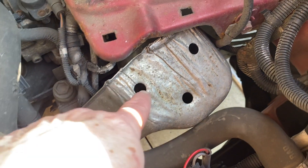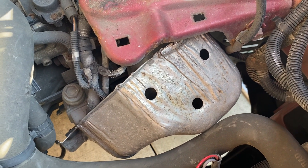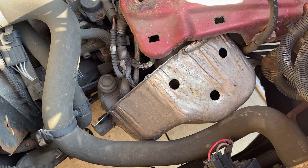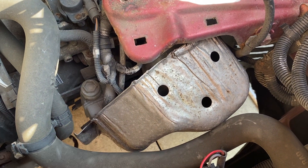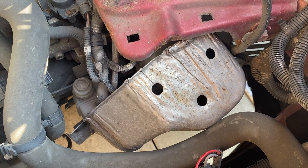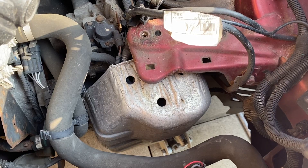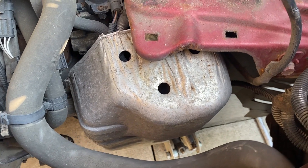To get this shroud back in is probably the fiddliest bit. I tried it from the bottom by pushing it up but couldn't do it. Then I tried it from the top after taking the air intake out, but couldn't do that either. So then I tried it from the bottom while under the car, jammed it into position, came around to look from the top, and once it's in at the top I can get it into position. That is what it looks like - I haven't tightened it yet but it's now sitting in the correct position.